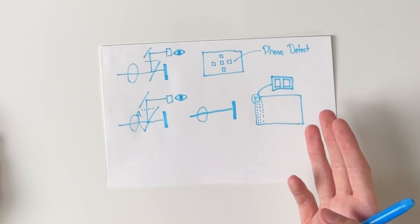There are cameras like the NEX systems from Sony which included similar technology — two photodiodes per pixel as phase detect points. However, those sensors had only between 5 to 10 percent of pixels as phase detect points. Canon, on the other hand, had at least 80 percent or more of its sensor covered in these phase detect points.